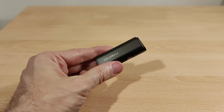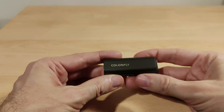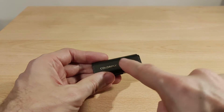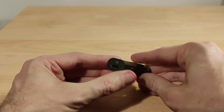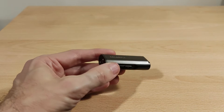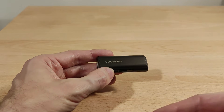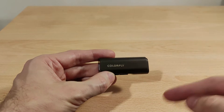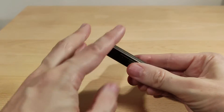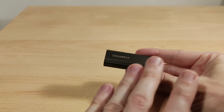I've been using this with Windows 10 and my phone, a Xiaomi Redmi Note 10 Pro. This has independent volume control — with Windows you set the OS volume to 100% and control volume from the dongle itself, sending full power to the DAC. I prefer that for Windows but not for phones — I prefer synced volume on Android. The Hidizs S9 Pro Plus is easier to control with a phone. This is better suited for Windows use because of the independent control.